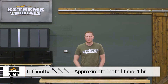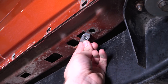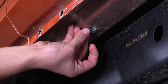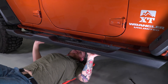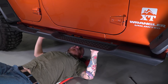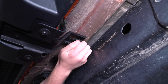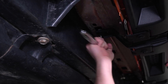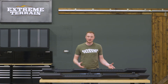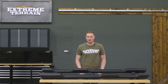This is going to be a very simple one out of three wrench installation that anybody can do in their driveway with just some hand tools. The first step is going to be putting any of the J-clips that come with this in place in the holes that are not threaded. These are going to bolt directly in place on your pinch seam and the underside of the tub, holding this up into place underneath the Jeep. This does have a couple of studs that will go through the pre-drilled holes in the pinch seam as well. Once these are held up into place, you can use the included hardware to secure them down. It might help to have an extra set of hands to get things started and lined up, especially to ensure that you're not going to scratch your paint.